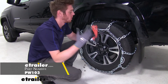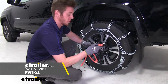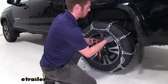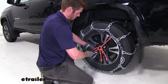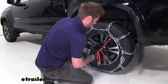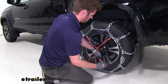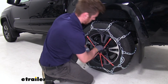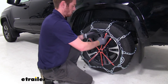If you tighten all these cams down and you still don't have the fitment you want, we can undo them and go back and grab a link that's a little bit closer to the chain, and that will definitely pull out the rest of that slack. We do suggest grabbing one of these rubber tensioners — they don't come with the kit, but it's a one-stop shop. We have them here at eTrailer. Make sure the hook is facing out and try to be as symmetrical as you can.